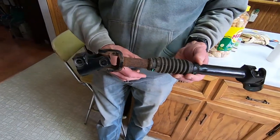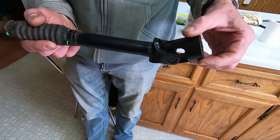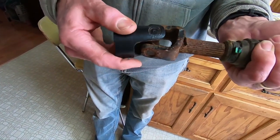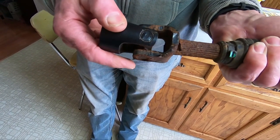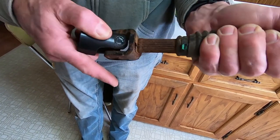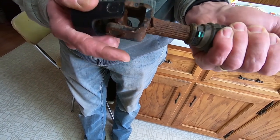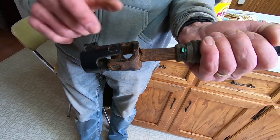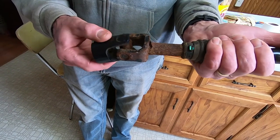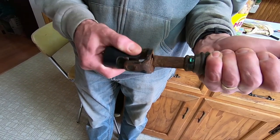Okay, very good. I cut your head off through that whole thing, I'm so sorry — that's okay. This is the old steering shaft. This end on the top is still nice and smooth and this is the bottom end. In this direction it's still smooth, but this way you can't make it move — you have to really struggle. I'm going to see if I can get a new U-joint because the rest of the shaft is good other than that one universal. So that's why I had to replace it. And I'm all done — saved us a big batch of money.